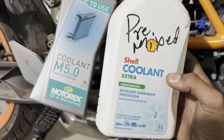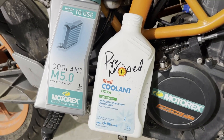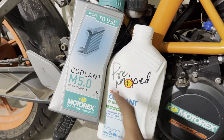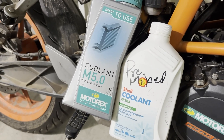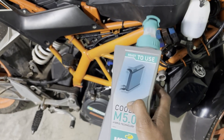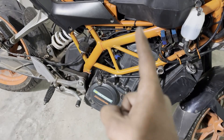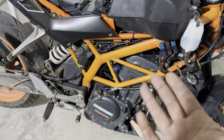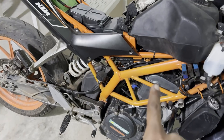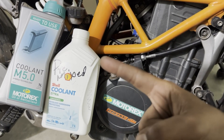So the problem could be either in the coolant or in the thermostat. The engine also used to feel a lot rougher with this coolant, probably because it is recommended for heavy vehicles. Now the engine runs a bit smoother with this ready-to-use coolant recommended by KTM. I am in no way associated with or promoting this brand, but this is what I have experienced. I have also made another complete video on cleaning and flushing the cooling system of this motorcycle — the link is in the description. I would suggest you use the coolant recommended by the manufacturer, or one generally used in motorcycles, and not the general coolant supplied for LCVs, cars and trucks — definitely not the one your automobile store guy pushes you to buy. Many thanks for watching and please subscribe for more related content on repairs.